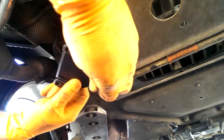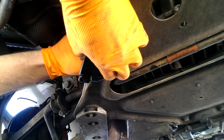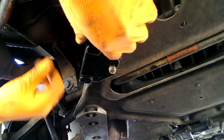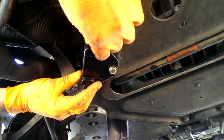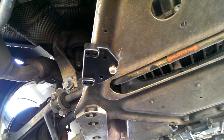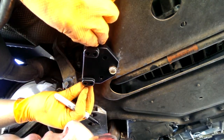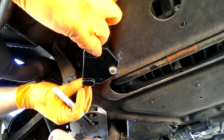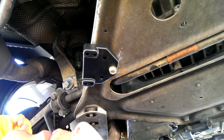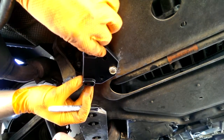The bracket — just to make it easy to lay out the last couple holes. I'm going to angle it a little bit towards the front of the car. It might not even be necessary, but if it's still going to hit flat spots we'll go ahead and angle it a little. Yeah, that'll be good. You guys can crosshair it this way through the whole center of the edge of that rail — that'll give you a good angle. I center punched both of those to give them a pilot mark to get started.